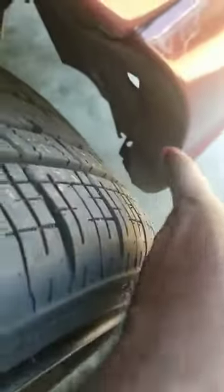A little fender trimming right here. Just trim this. Make sure it's a straight line. Just start at the bottom. Just trim all the way up like that. And then as you get it up, man, just kind of shave it down so there ain't no sharp point so it don't catch the tire. Man, knock this down, man. And just, like I say, just test it, man. Turn it, see where it rubs a little bit. Cut this, man. Man, you rolling, dog.